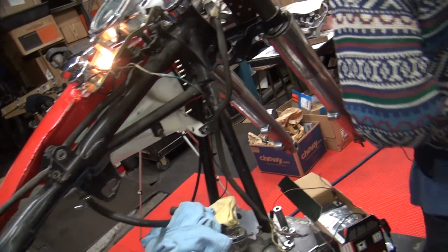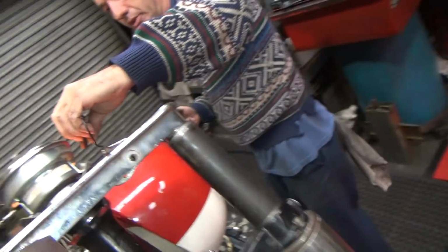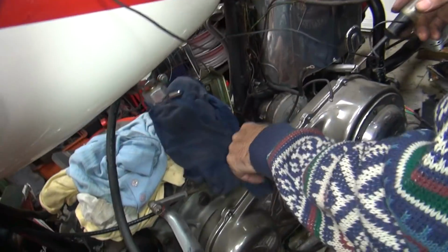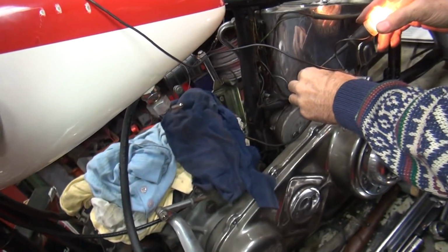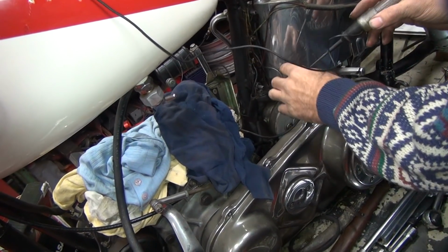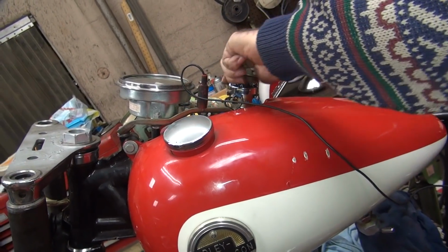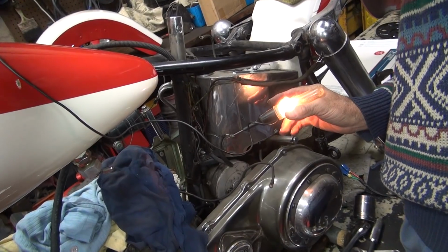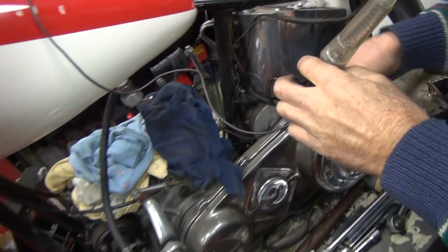We have to go back over here and check our ignition for a coil, which should work if they use the correct wire. So this one is the ground because it goes to the points. So this is our hot wire. There you go. This one's dead. It's not connected. So off, on, off, on. So ignition stays on when the lights come on. That's a good sign. So that's a hot wire. Don't touch that to anything.